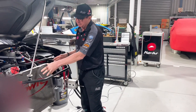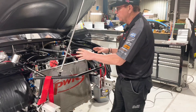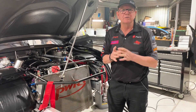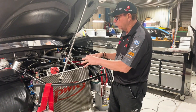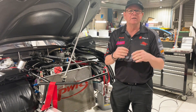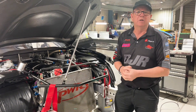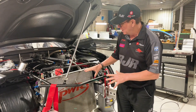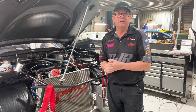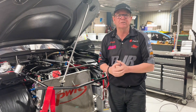If you look at the one in the Camaro, it's 50% bigger. It's a control core which PWR makes, so everyone's got exactly the same thing. We will go through a whole season just with the one radiator. It's so big that the engine runs a thermostat like a road car, so it blocks off all the water to get the temperature into the radiator and into the engine. When it gets up around 75 degrees, it opens up and lets some cool water back through the system, then it will block if it goes below 73 and warm it back up again. There's also a cost saving with this — besides the fact that we have one for a season compared to three, these are a bit over $1,000 cheaper. So this is about $3,800, and we used to pay just under five grand for one of those.